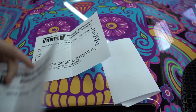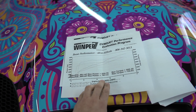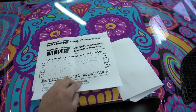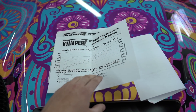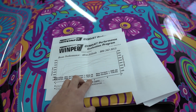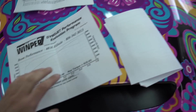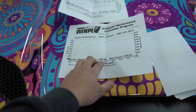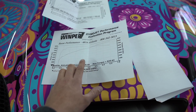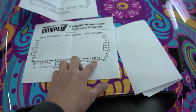Let's go to this one because it has my stock numbers on there, so you can compare to what your car made. My car completely stock: 654 horsepower, 605 torque to the wheels. Then with the 265 upper pulley, intake, no lower, no injectors, just upper, intake, cat delete, and the stage 2 Snow Performance methanol kit: 787 with 730 torque. Then I added the lower pulley, upped the boost about 2 to 3 psi — I'll check on the exact boost settings — and got 848.99, pretty much 849, calling it 850. And 825 torque. That is a shit ton of torque.